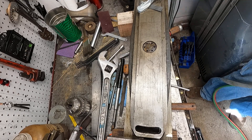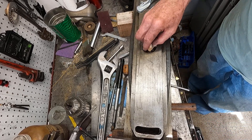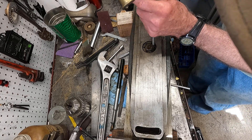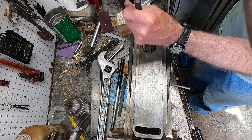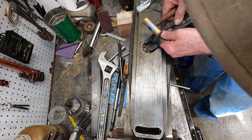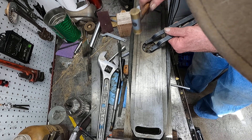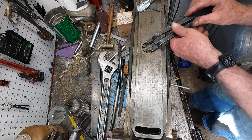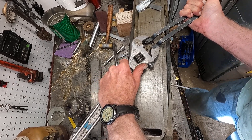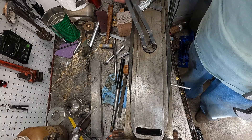Okay, I'm going to give that a try. A little more beeswax on there. Just going to tap on this a little bit. I'm going to put the pin spanner in and just see if we can crack it loose — it might not work, and then I'd have to go to plan B. Let's see if we can crack it loose without destroying this wrench. It did! That was not going to come loose without heat.